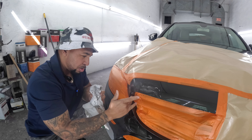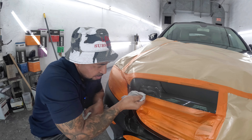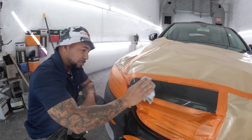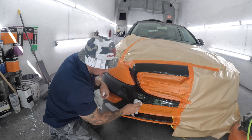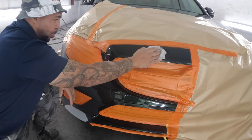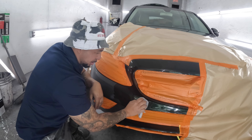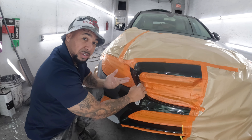I told my prepper to bring it around this lip here, but he didn't listen. Everywhere you're going to put your blending agent, go ahead and just give it a little scuff. Then take the wet part of the rag and wipe that off — wipe everything off using the other side of the rag. Clean it off, fold it again, go to another clean area where it's just wet, and wipe it all off. We could remove the little tow hitch cover, but again, you're just doing a little quick spotting job. It's what the customer paid for.